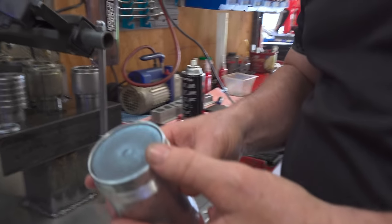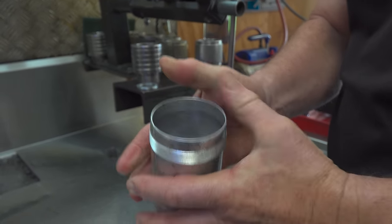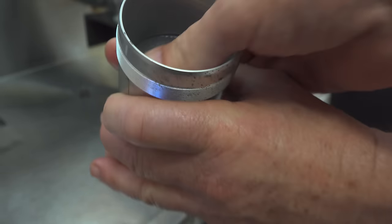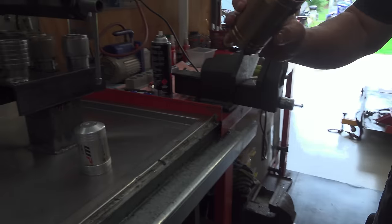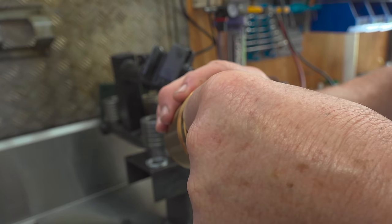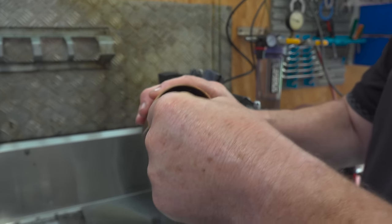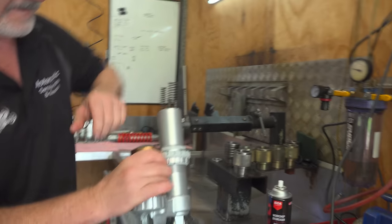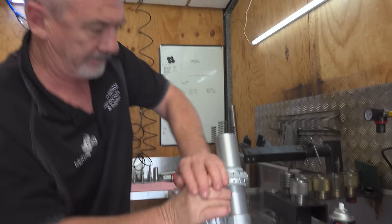Yeah, so here they are. So again, how much pressure it takes to start making it move. Interesting, isn't it? When you've got a diaphragm, it's surrounded by oil on this side, gas on the other, so it just flexes immediately. As soon as you put any pressure on it, there's no friction point for a bladder. We've gone from piston to bladder.